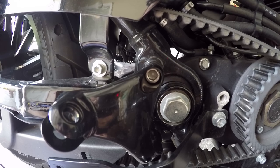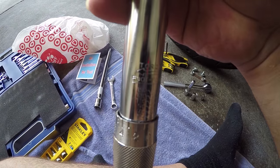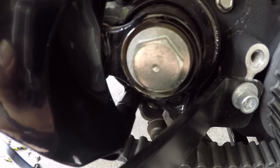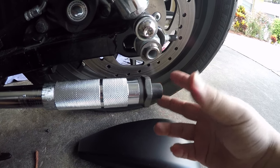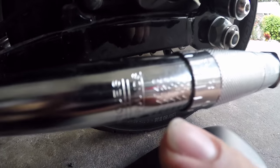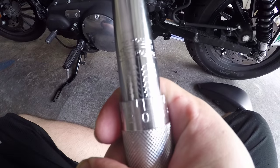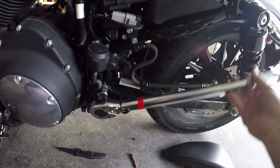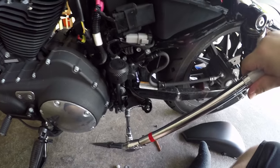Got the bracket on there. The manual says to torque these bolts down to 45 to 50 foot-pounds, so grab your torque wrench and set it to 45-50 foot-pounds. If you guys don't have one, invest in it — incredibly valuable. Don't over-torque the screws and strip them. Quick how-to on the torque wrench: loosen it up, adjust the handle — you've got markings like 2, 4, 6, 8 — find your foot-pounds, set it, then twist until you hear it click.